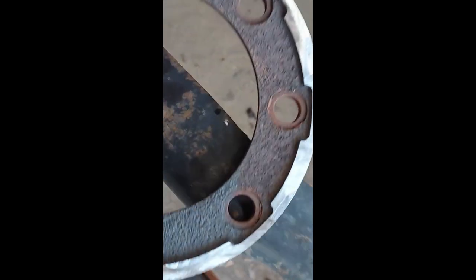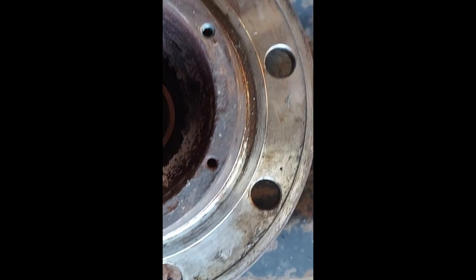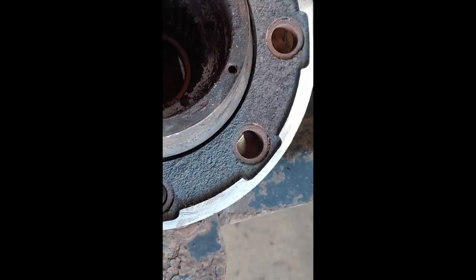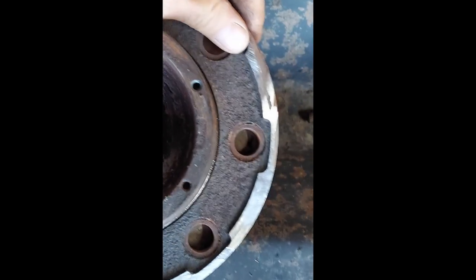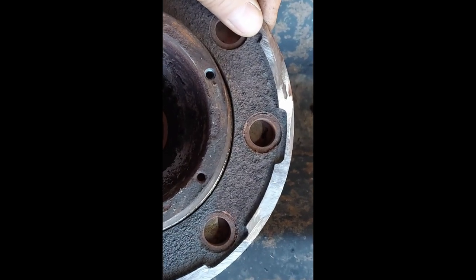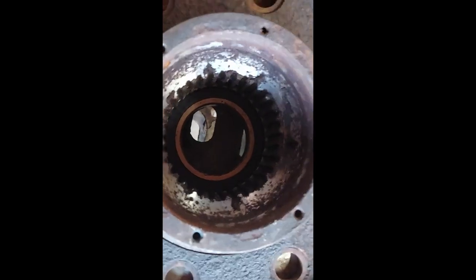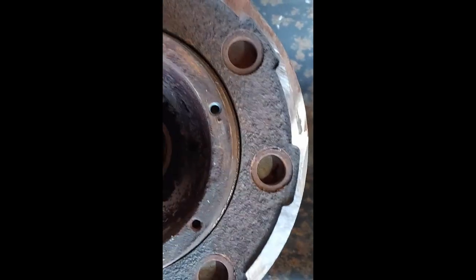So what I'm going to do to hold this in place, I'm going to drill a hole on opposite sides right there. And those holes won't line up perfectly with the original metric pattern, but I'll use a smaller bolt so that will give me room to move this about. And then where I'm happy where I've got it, I'll tighten the nut and bolt on each side and lock it down and then double check and make sure it hasn't shifted.